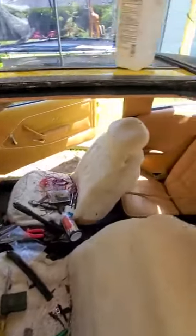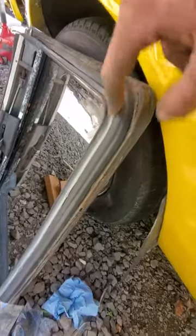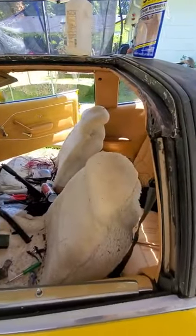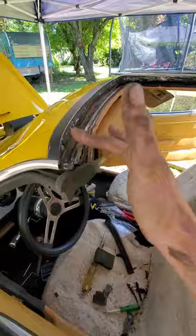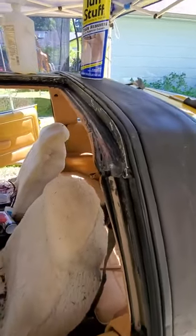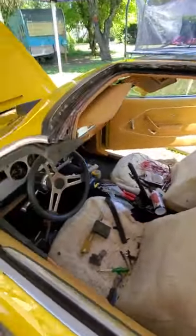I will be replacing that felt piece. It did not come with the Mustang 2 T-top kit that you can get off of the Reproductions website. That T-top kit comes with the A-pillar, B-pillar, and the inside gasket for the T-top itself — all the way around. That is what that kit comes with. It does not come with the felt, which is super disappointing because the felt is used on the 1978 T-top. You may have to order a Fox body felt piece. I'll try to show the passenger side being done, but this is it in progress.